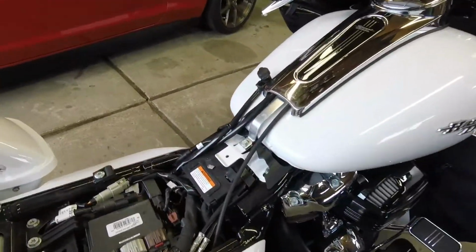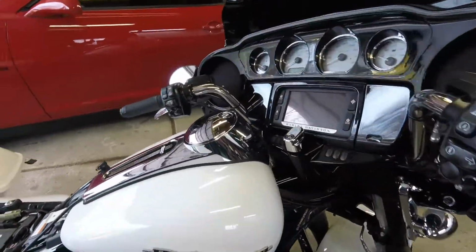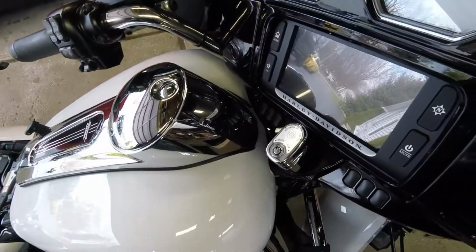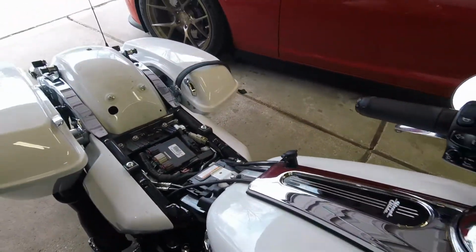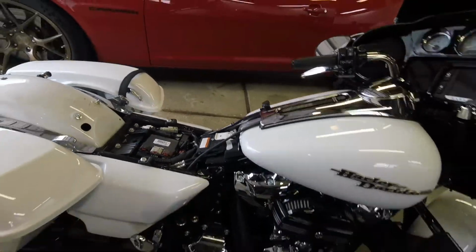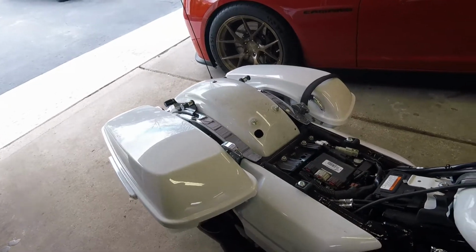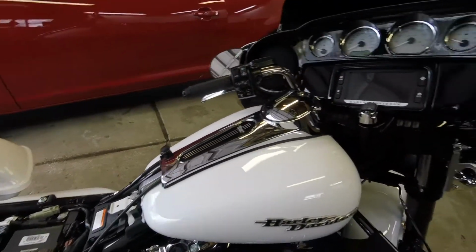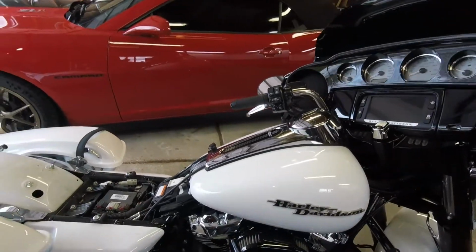And then we'll have a nut right there, and then we'll have a screw up on the front as well to take off. There's one right up in there. So it's probably going to be standard. I'm assuming Harleys are standard, so you've got an Allen screw and you've got a bolt down there. So I'm going to get doing that. That got pretty dirty under there, huh? I'll get taking that off, and I believe you also have to remove your fuel cap to pull the console out.